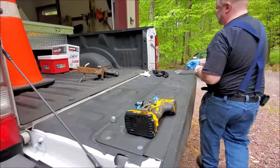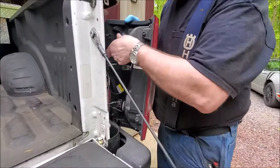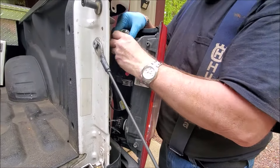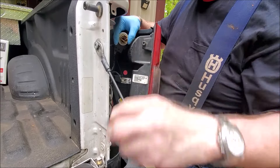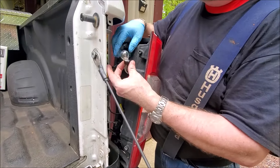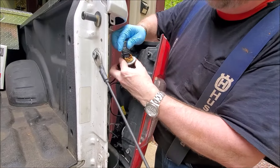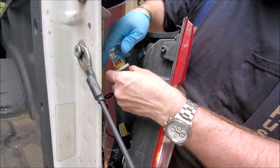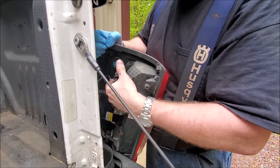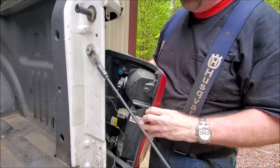Just one more time on this side. We've already taken the bolts out — same thing. You want to pull that and turn this counter-clockwise. Take the old bulb out, then you're putting your new bulb in. Try not to touch this with bare hands because you want to keep any oil and grease off that. Put that back in, then turn it back down clockwise so it basically locks in.